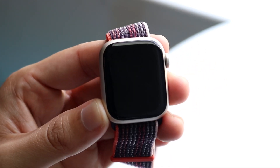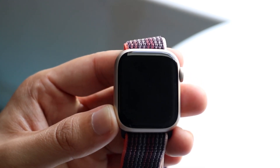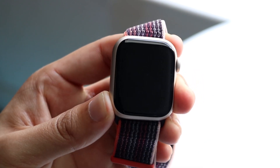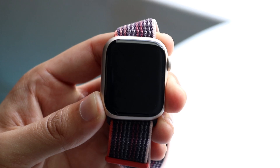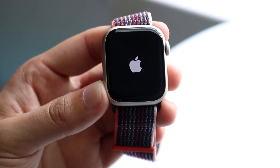It can take a few seconds — the delay is a little more noticeable than on iPhones, but it's totally okay. When you're ready and want to turn your Apple Watch back on, hold down on that same button. You'll see an Apple logo come up, then you can let go and your Apple Watch Series 8 will go ahead and reboot.